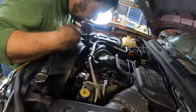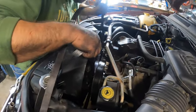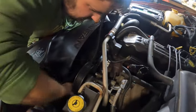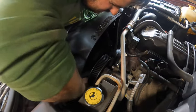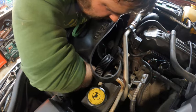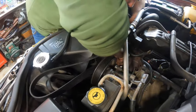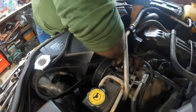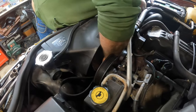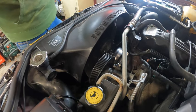So, sorry about that. Camera issues, camera guy problems, mainly I left. I left Scott here to figure this out on his own, and he had it pretty well figured out. It's just getting this belt on now. The hardest part was getting that fan clutch assembly off. Fan clutch loose, yes. The right technique is to get the right tool. Short of that, take your belt off and you can clamp a vice grip on the pulley, like we did, and then it should come apart.